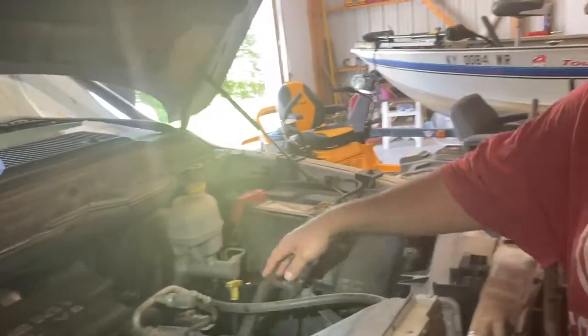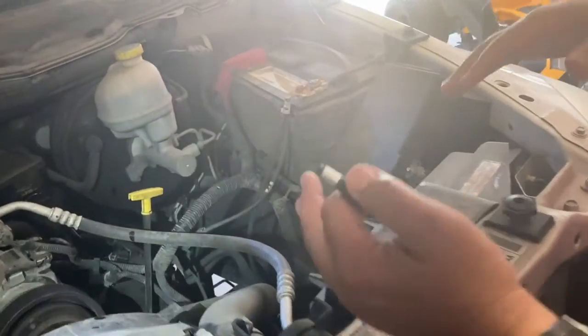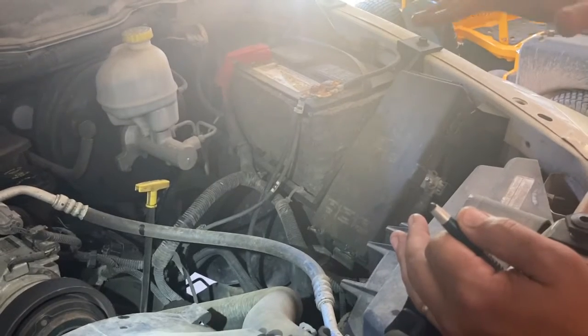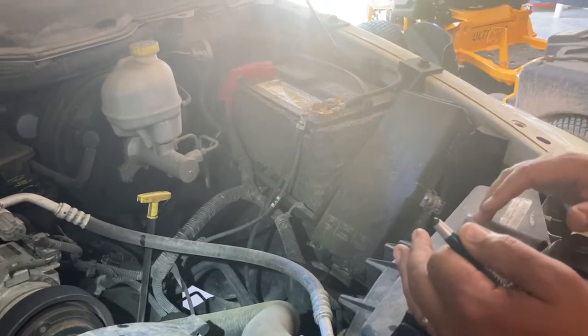We already talked about the engine oil. We pull out the dipstick, take a look at it, and there's marks that'll show you where it needs to be. If you need to add a little bit, you don't want to overfill it. And the hatch marks in there usually give you about a quart range on most vehicles, so that if it's all the way down to the bottom hatch, you can put in another quart.